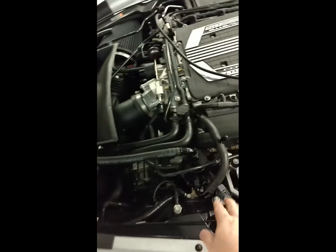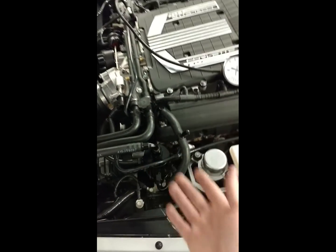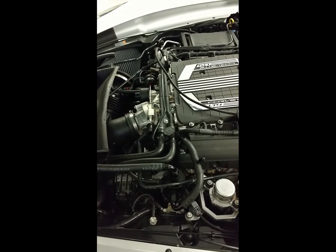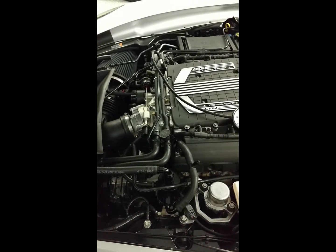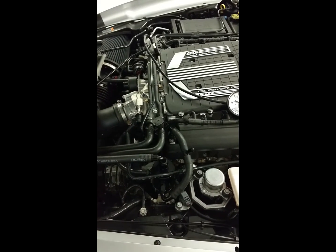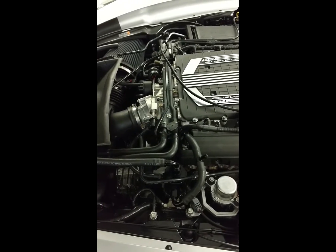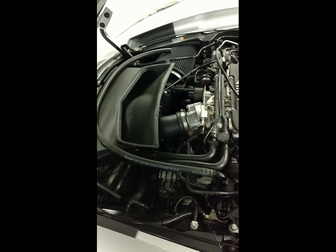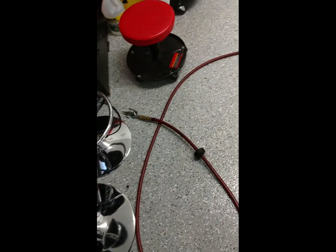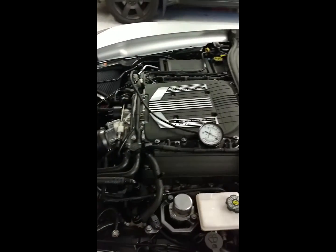This one, of course, because we're using the 10AN line, much like PCV acid test two, it's a much better connection for high power or high crankcase pressure situations, because we can fit more air through the line, and it keeps the crankcase pressure stable even under extreme situations such as blasting it with an air compressor. So we'll just get right into it.